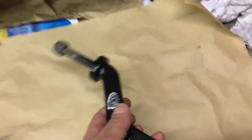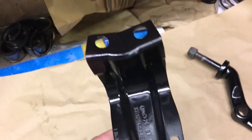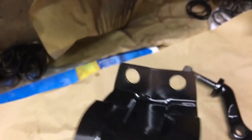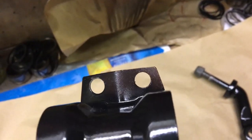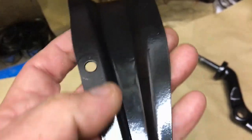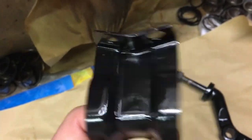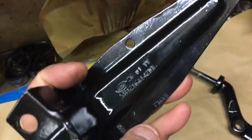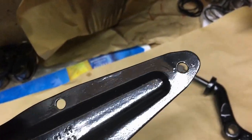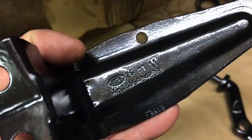Here's one of the pressed steel brackets from underneath the bonnet. You may see some evidence of the corrosion around those holes and the paint is a little thin - you can see the red showing through. But again we've got this orange peel finish, which I'm not going to fuss too much about unless it's actually quite grainy, in which case I'm going to rub it down and do it again. It's worth doing once, it's worth doing right.